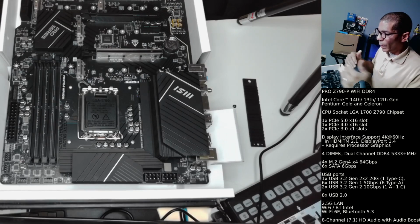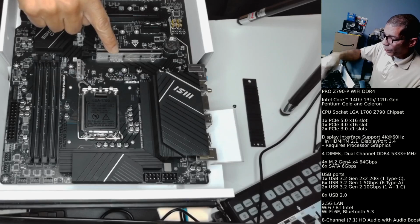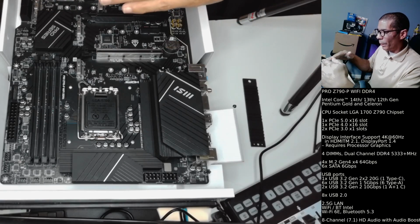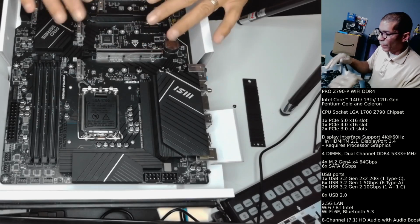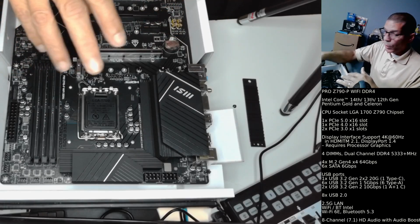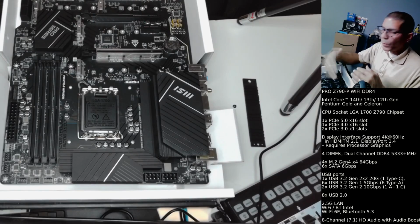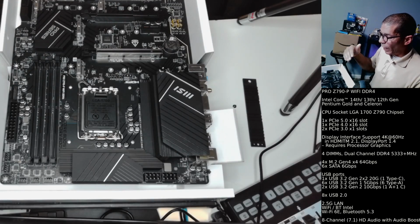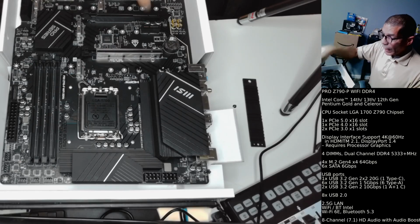The same thing goes with the video section or the cards section. This one here has higher priority than the other ones, again because this is a gamer motherboard. So the idea is that you're going to have a dedicated card for video with its own processor, which still needs to talk to this other processor and perhaps some of the memory, because the card will also have memory, but you still need that fast communication at a higher priority. So you have several pieces of the motherboard itself which have a priority ranking, or hierarchy, and with that comes a designated maximum speed that they can transmit inside the motherboard.